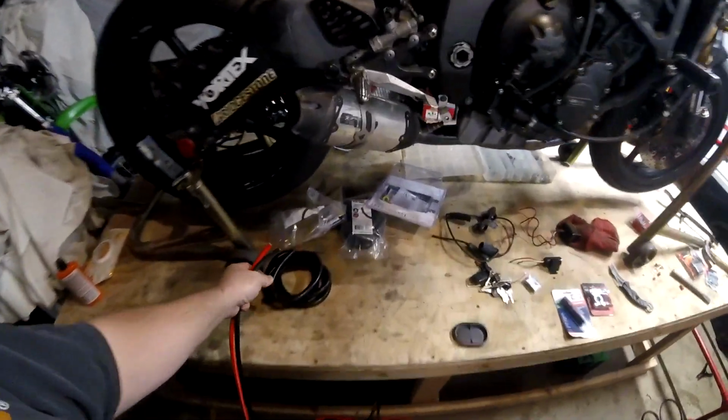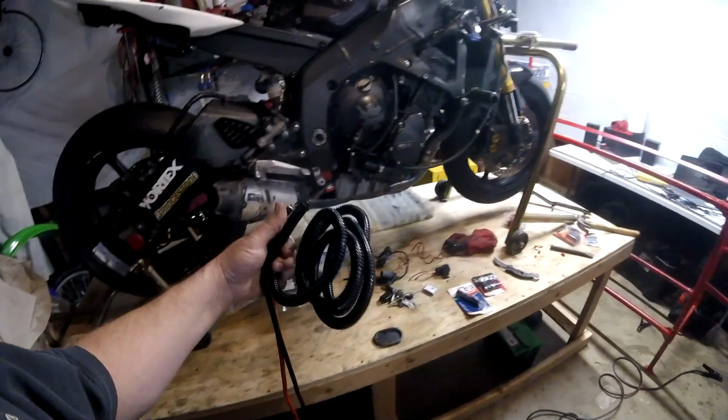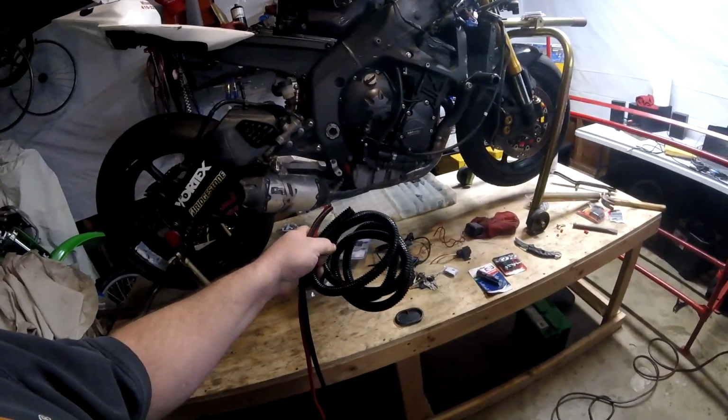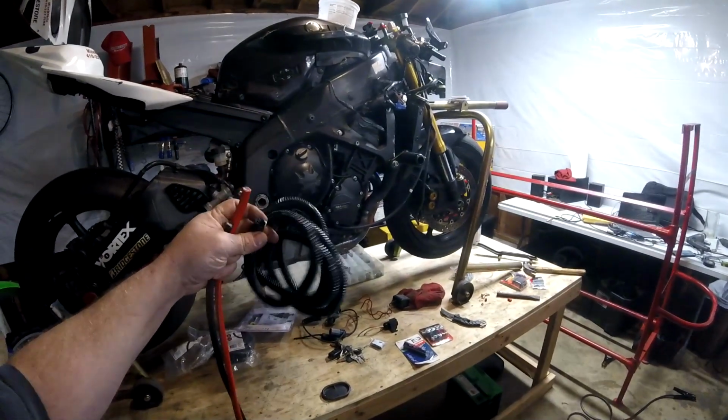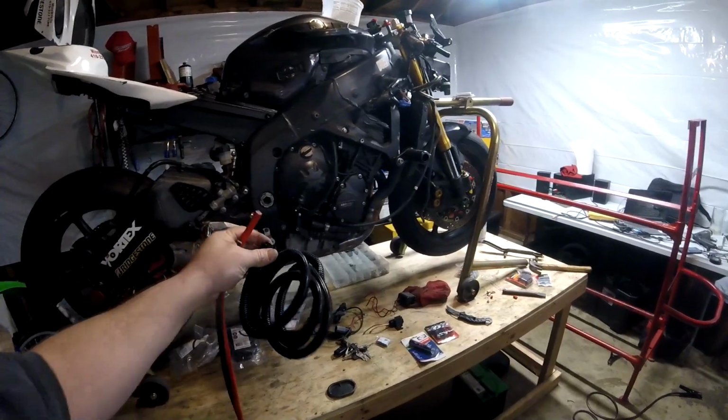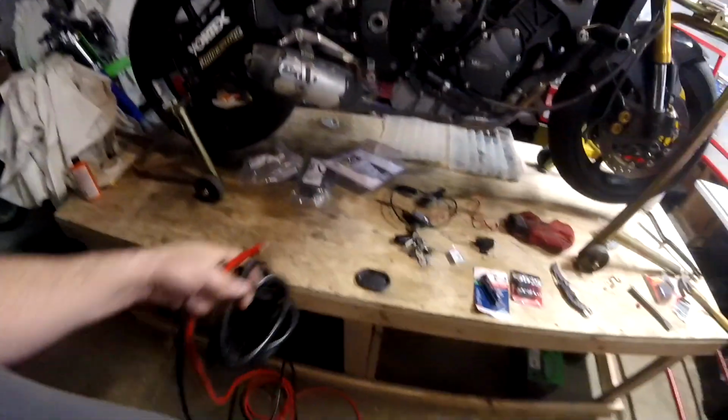So I'm guessing it'll take 30 years of operation before these wires ever short against each other like that. But this is how the professionals run hots and colds together. They do it with insulation, serious thick protection like that, and they do it post-fuse, not between the fuse and the battery, but after the fuse, away from the battery. That way, if there's a short, it kills the fuse and shuts the system down. All right, I'm going to stop rambling and preaching.